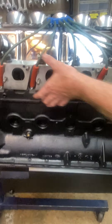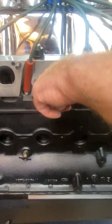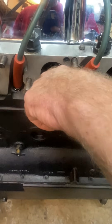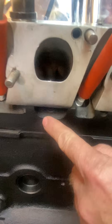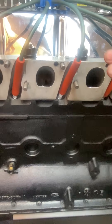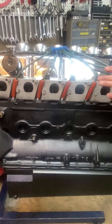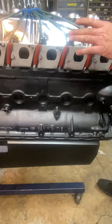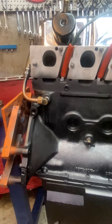So what they actually do is they cut off this side of the head, take a port and put it here. Now this port runs down into the valve bowl area, but it used to be down here — you can see the bottom of this port has been raised about an inch and a half. That is a tremendous, tremendous pro stock-type modification that all the big names were doing, and Bob Glidden was the biggest who was doing this back in the day.